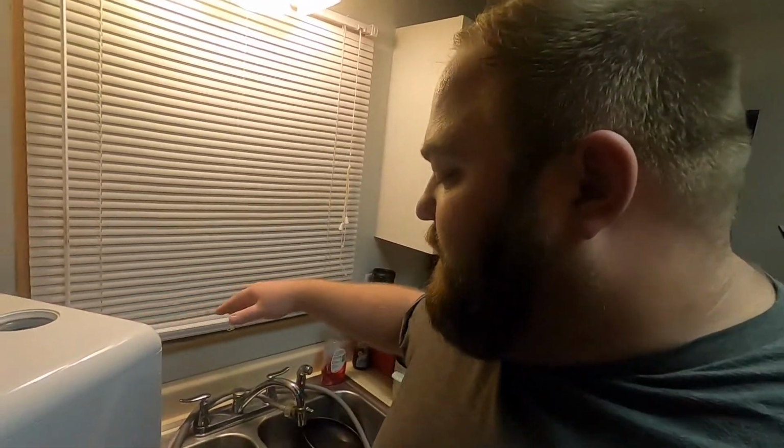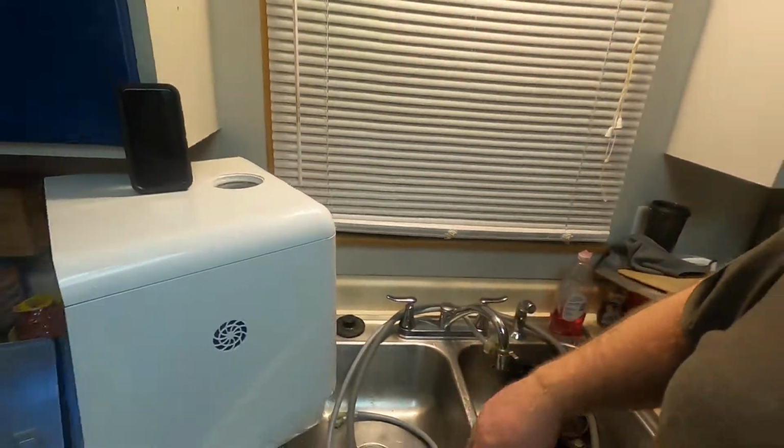The air refresh is simply to keep the air flowing through there. It doesn't technically have a drying system, so there was still maybe some water on the top of the cups that went through the cycle. We ended up opening the door before the entire cycle ended, took all the clean dishes out, and then refilled the water through the faucet right here. Then I loaded up all the new items, pressed the power button, and started a normal cycle. That is when, almost immediately, the E4 code popped up.